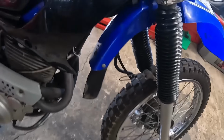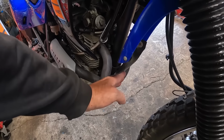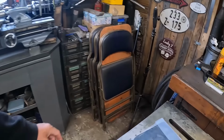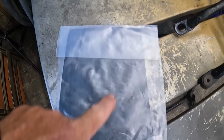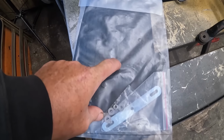That has melted, so it's quite obvious when you're trapping along on the bike, this thing's blowing up like Marilyn Monroe's skirt and resting against that hot exhaust. You see that little alloy strip in there? We've got an aluminium strip with this one. Well, I think this one's actually steel, I haven't had it out of the bag yet. To me, that needs a T-piece, so the bit that is flapping around can't reach the exhaust. Why haven't they spotted that and made that little sandwich plate into a T-piece?